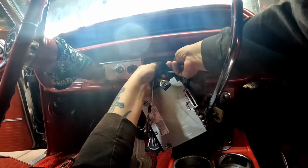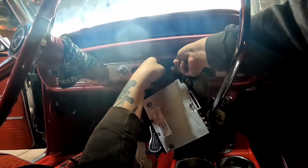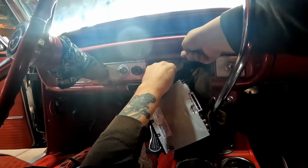One thing you never do is hook up them RCAs and that remote wire, put the radio back in, and then run them in the back. I am actually going to put the radio back in now, but not till after I zip tie those RCAs somewhere where I'm not going to pull them too tight. Flush cutters, get yourself some. No zip tie razor blades on my clock.